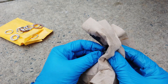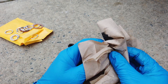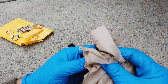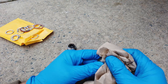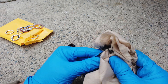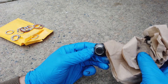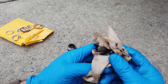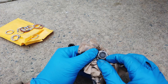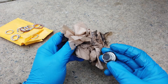This is a 65,000-mile fluid change. It was brand new prior, and it's recommended every 35 to 50 thousand miles if you don't take it off-roading terribly much. We take ours off-road every now and then, but I'm just now getting around to it. So that was pretty dirty — I'll let you guys be the judge of how dirty yours was.